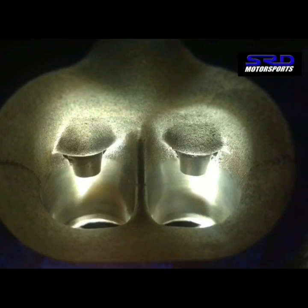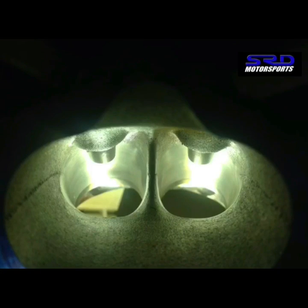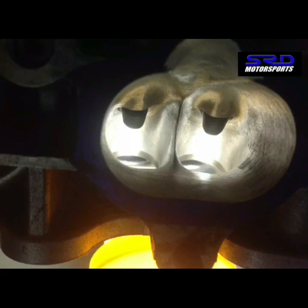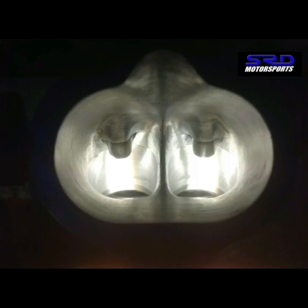After achieving what we previously discussed, notice the bowl, the short side, and even the sides of the port — it's very consistent as far as transitioning towards the bend. We have slightly widened the short turn, as it has the most airspeed, to sort of equalize the delta of airspeed between the short turn and the long turn radius, because this way it's more efficient. While we're at it, we decided to fluff and buff the whole port, starting with 80 grit and finishing it off with 120 grit.